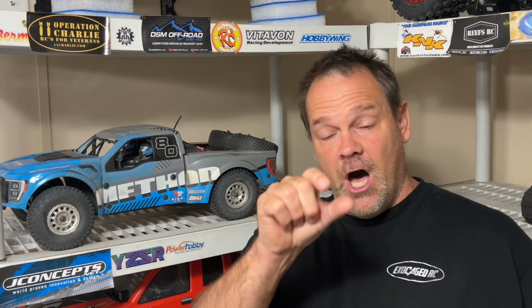I much prefer the sway bar links being closer to the axle, because if you put it up by the fulcrum, like say right here, the arm has to move like 4 inches to get half an inch. So you have to have a stupid thick sway bar to get any decent action at all. And it's just not as effective as having it out at the axle. Or on independent suspension, the closer you have them to the hinge pins, the less effective the sway bar is. Honestly, it's just basic leverage.